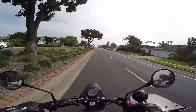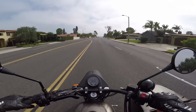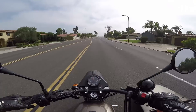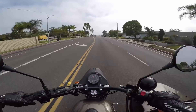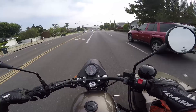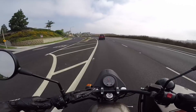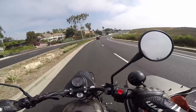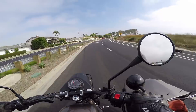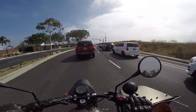One of the reasons I got to be excited about this thing is I grew up with sidecars. My dad had sidecars, and he also had BMWs. I actually raced a vintage sidecar for a while — it was a BMW R75 engine with a sort of custom chassis, made to look like a sidecar of about 1970. The R75 BMW had the same basic engine, really: air-cooled, two-valve, pushrod, 750 cc opposed twin. And like I said, that's no accident, because Ural basically reverse-engineered a BMW sidecar sometime after World War II and has been cranking them out ever since. That's why it looks just like a BMW. Anyway, a bit of a soft spot for me with sidecars and with BMW air-cooled twins — or even knockoff air-cooled twins. That still counts.